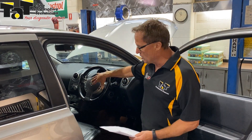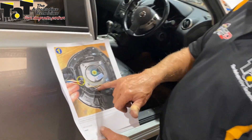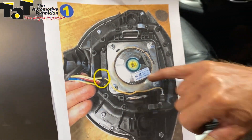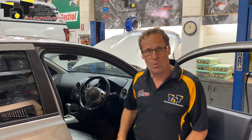Pretty basic. Once we pulled it all apart to put the new clock spring in, we took the horn contact off — you can see a picture of it here — and the wiring was actually broken. We've had a couple of these now where the wiring at the back of the horn pad is broken. Once you take the horn pad off, check that wiring, because movement in the steering wheel has a tendency to break that particular wire.